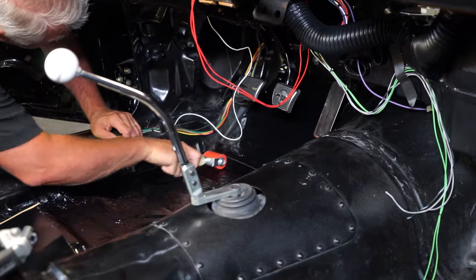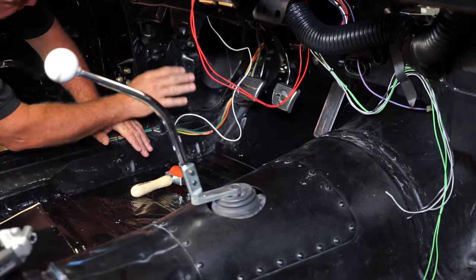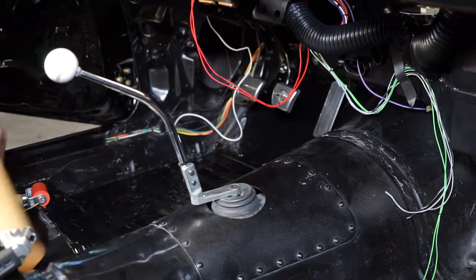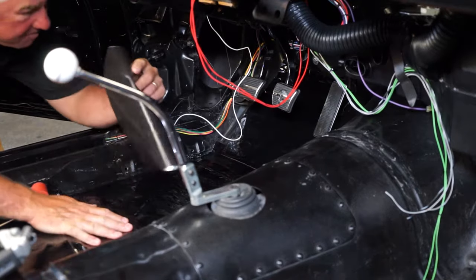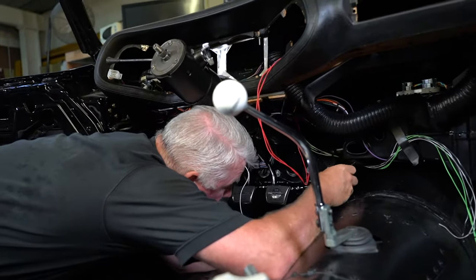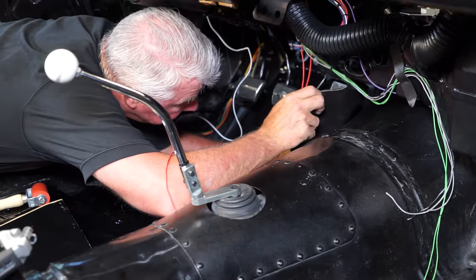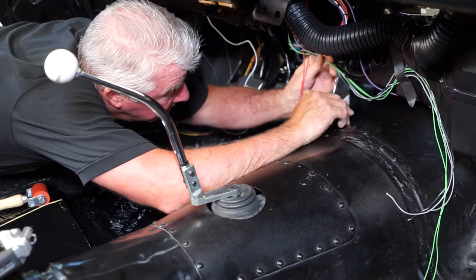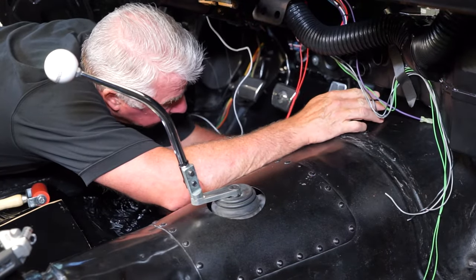Now as the wiring finishes out, I'm not going to go all the way to the edges. I want to make sure that the wiring is all done and then we'll go in and fill in the spots that we haven't covered. Always make sure you put the wiring on top of the hush mat, just for easy access for maintenance and so forth.